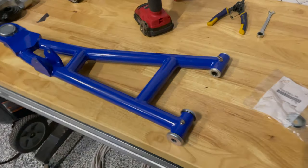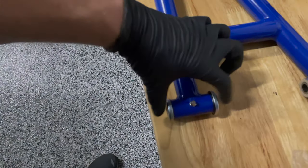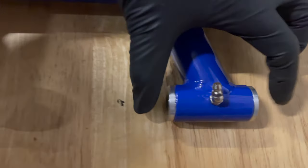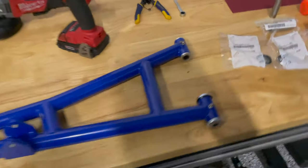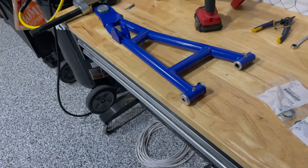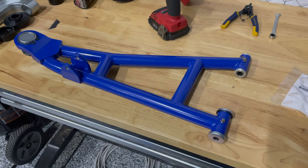This is what a completed one looks like. I'm going to install it on the car and make sure it moves properly and that my bushings are tight enough. If you don't get those compressed all the way in, they're too wide to fit in the slot where they belong on the car. The first time I ever did a long travel kit, I didn't grind off the powder coating and it added like a millimeter of width — you'd be amazed how much that throws everything off. I'm going to get another one out and take some video while I do it.